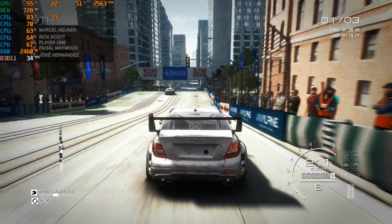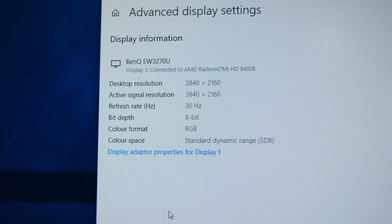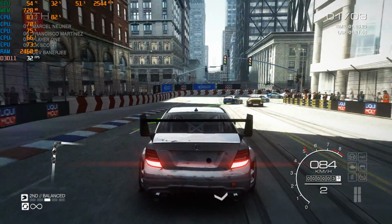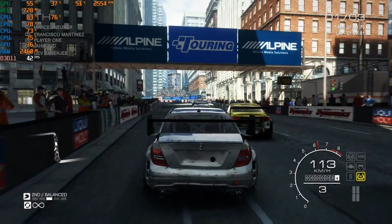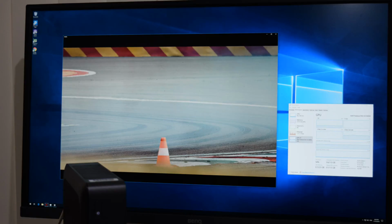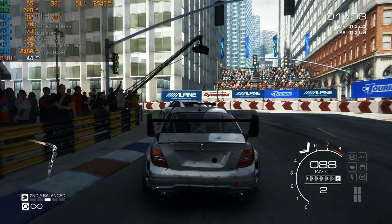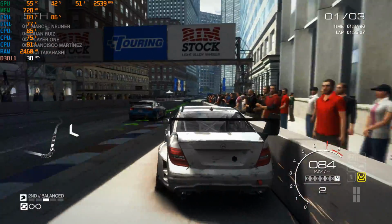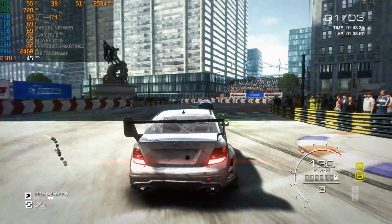But let's come back to the machine. So out of the box with the integrated graphics, we get 4K up to 30 Hz. So for media playback, that's actually not too bad. But the display device I eventually ended up using was 1080p. So with the integrated graphics, Netflix at 1080p works just fine, and you can actually open Task Manager and see the GPU acceleration working. YouTube 1080p worked fine as long as you stick to the H.264 codec. So for Google Chrome, there is a plugin, because by default it will use the VP9 codec.